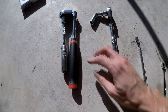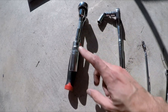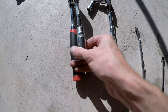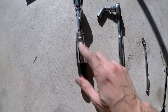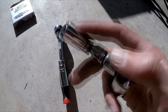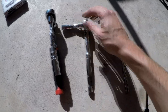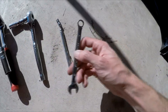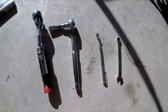The tools I'm using are going to be just a half-inch drive with a 9/16ths socket. You're supposed to use a 14mm, but 9/16ths is the closest I had on a swivel from another project, and it works just fine — I've already done two with it. This here is just a little elbow to get the plugs off when they're in a weird position. A little magnet just in case, even though this already has a magnet on it, as well as just a 10mm. There aren't very many tools you need at all.